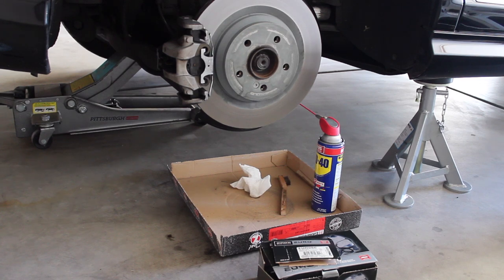I got a little ahead of myself — I already took the wheel off and jacked the car up. I had a seized wheel bolt so I had to deal with that off camera. The car is jacked up by the rear differential with stands under the rear lift points for stability. When jacking up the rear on one of these cars you definitely want to chock the front wheels very well — I used four chocks total, front and back on both front wheels, since you don't have a parking brake in front.